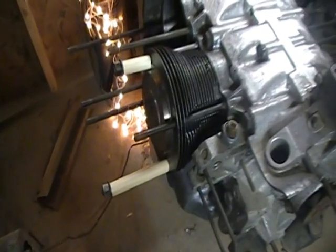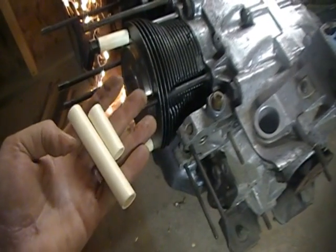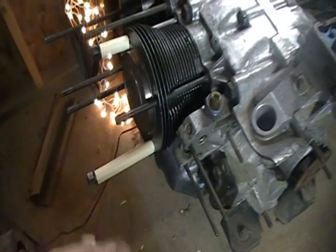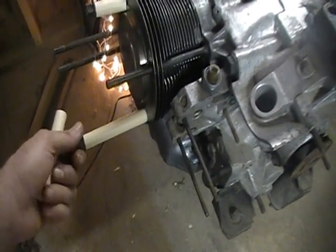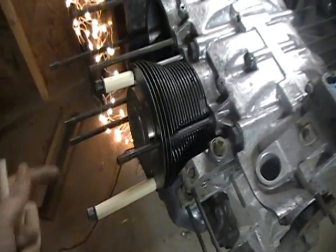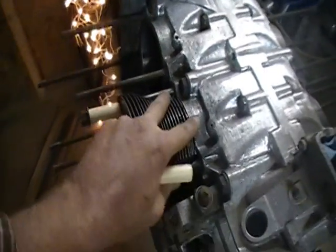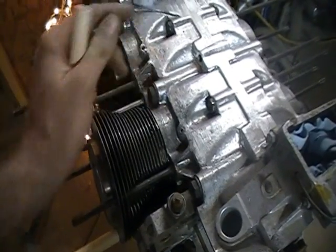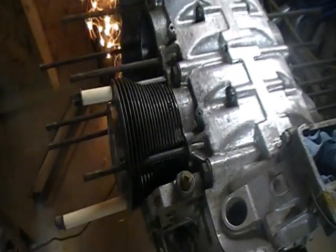I want to show you a little trick I use. I take a regular half-inch PVC pipe and cut four pieces - one at one and three-quarter inches and one at three and three-quarter inches. I just slide it against the top of the cylinder and tighten it just a little more than finger tight. The reason I do this is that as I turn the motor through its strokes to put the other pistons on, it's going to want to push this cylinder back off. I've already got sealant and my gasket on there and I don't want to work that seal back and forth - just a little tip.